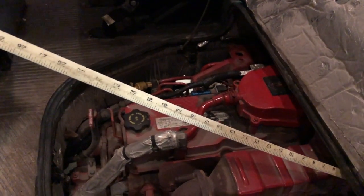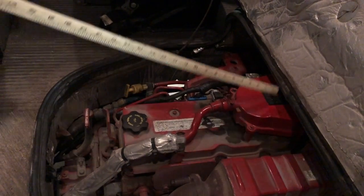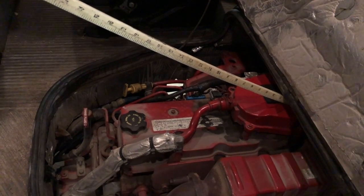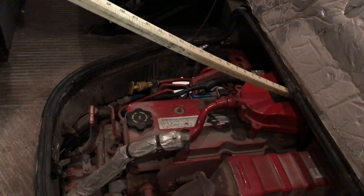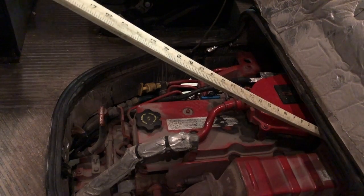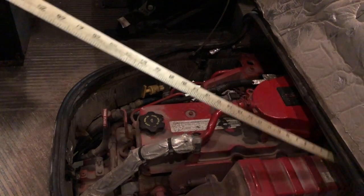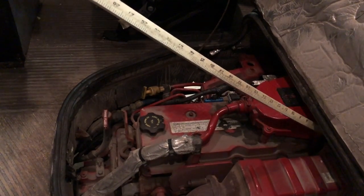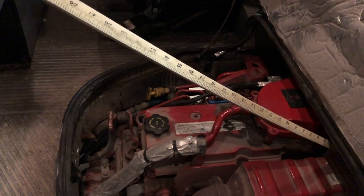Opening the doghouse. I would check my alternator, located up at the front right of the engine — making sure it is secure with nuts and bolts and there are no loose wires. I would check my water pump — it is secure with nuts and bolts, the hoses and couplings are secure, there's no dry rot, no leaks, and no puddles. I also have a serpentine belt connected to the water pump and the alternator — its main function is to recharge the battery. The serpentine belt is not cut, not frayed, not damaged, and it is secure.